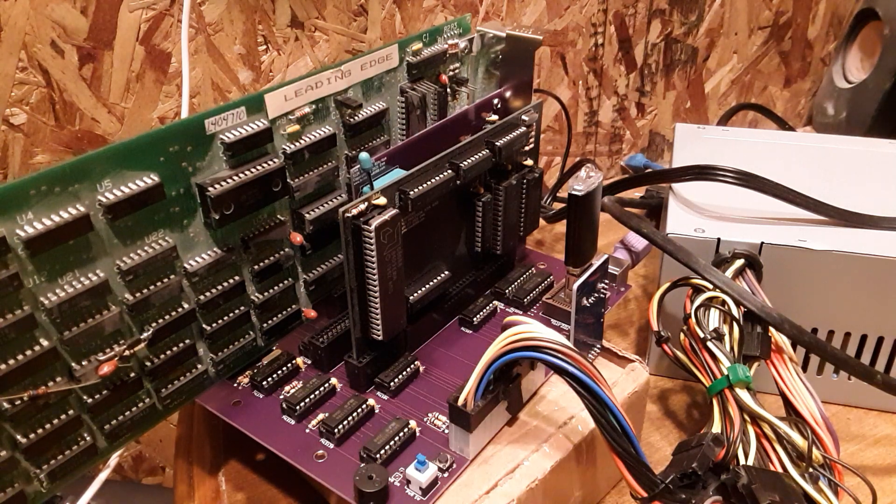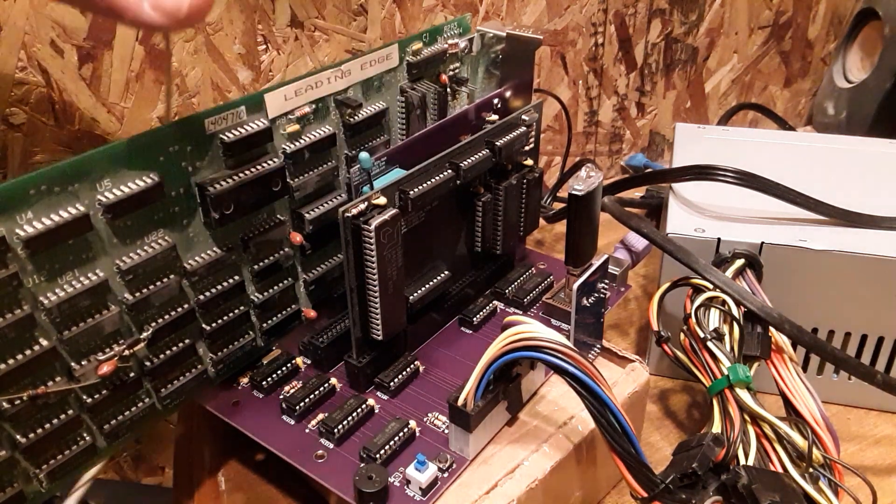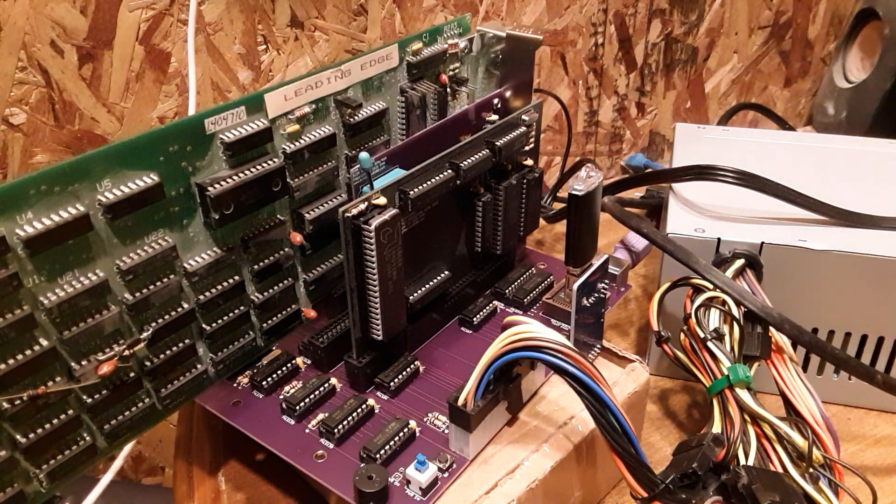Let's give you a quick rundown on what we're running for hardware, and then we'll run the demo. I originally tried this on an 8MHz board with a VGA monitor. Seems that it's actually designed to run on a CGA card with a 4.77MHz processor, so that's what we have today. I've got my main board here — this is the new one that's got the PC speaker fixed — and then I have a 4.77MHz processor card with an actual 8088 on it, not a V20. 512K of RAM with the ROM, and my CGA graphics controller.